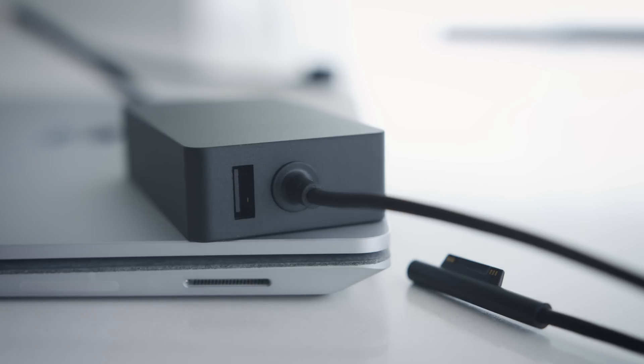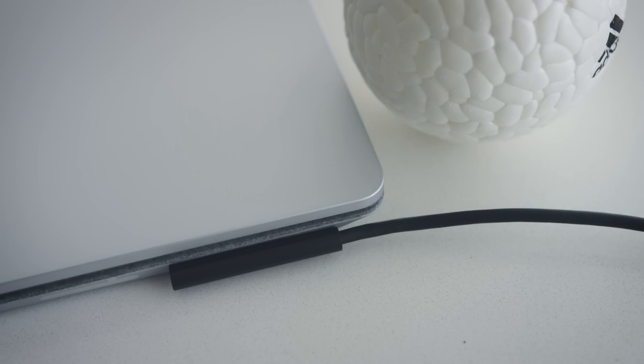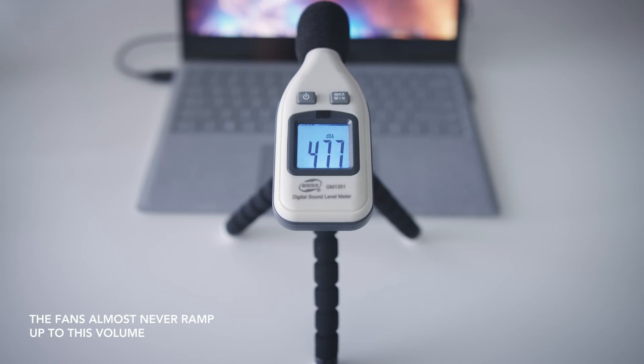Battery life was one of the headlining features of this laptop, and it's excellent. It's a 45 watt-hour battery, which isn't actually that large for a laptop of this size — ultrabooks sometimes have 60 watt-hour batteries. This one's smaller, but I can comfortably get eight hours doing normal tasks with the screen at around 250 nits. Thermal performance is good. It runs quietly and the fans don't come on often even if you're watching videos, but when they do, it's louder than you'd expect for a device like this.